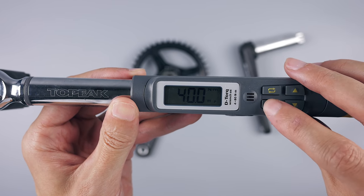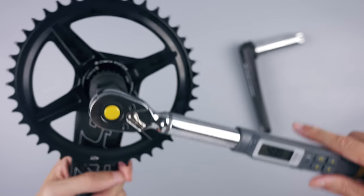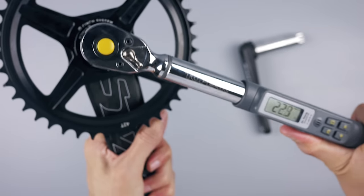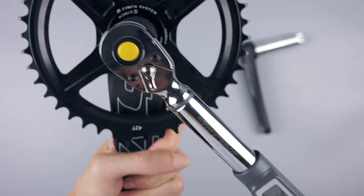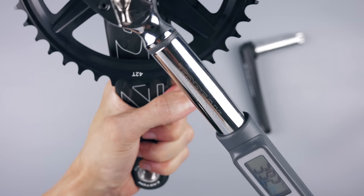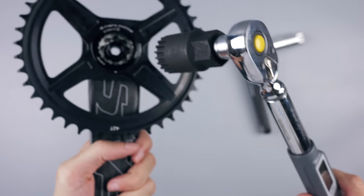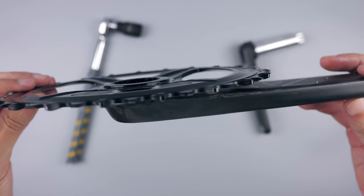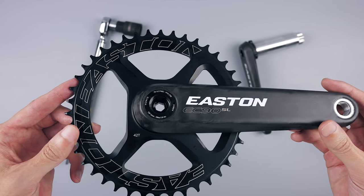You can find these tools from Park Tool or cheaper alternatives on Amazon. The torque specification is 40 newton meters. If you don't have a big torque wrench, you can strap the bottom bracket tool into a vise, thread the crank onto the tool, and turn the crank by hand. If you're worried about getting the correct torque, it's about the same as you'd put on a lock ring on a cassette. That's all there is to swapping chainrings on this crank with the Cinch system.